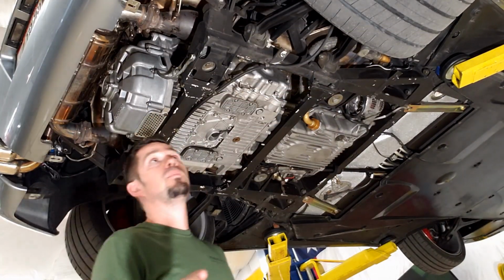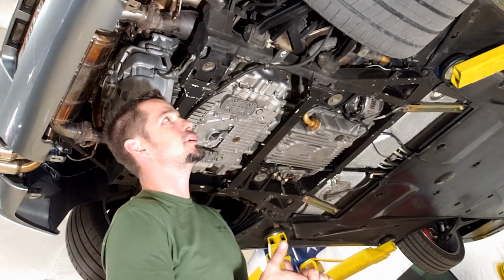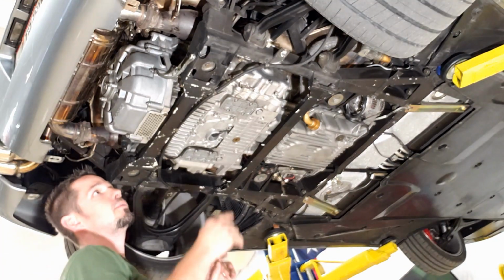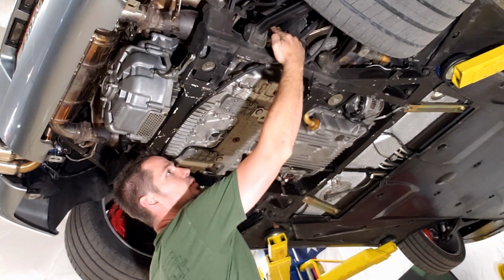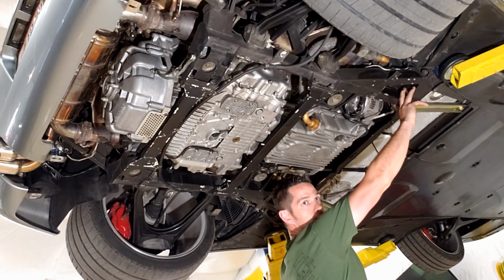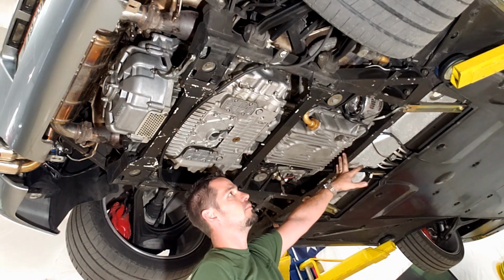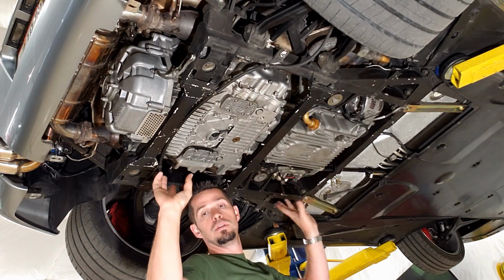While we have the car up on the lift, I'll give you the 10-second version of how to do the engine out. Evacuate the AC, remove the bumper, remove the muffler. From there are bolts, 2 bolts here and here, 2 bolts way up top on either side, 12 bolts here. Those are the main things that hold everything else in. Undo the coolant lines and AC lines that go to the firewall. After that, the assembly sets on a cradle and you lift the car away.